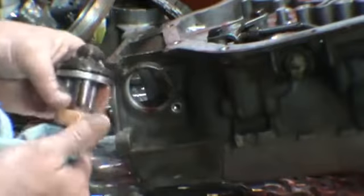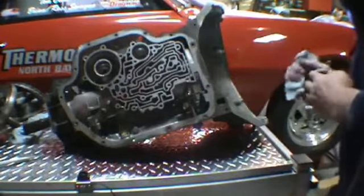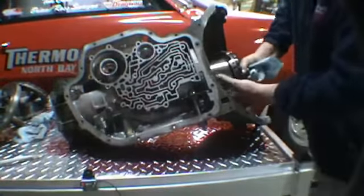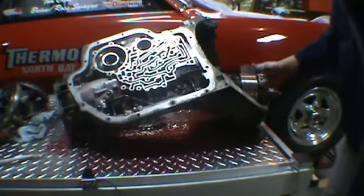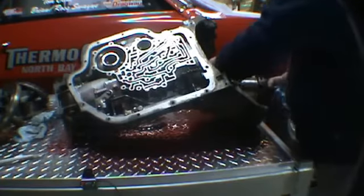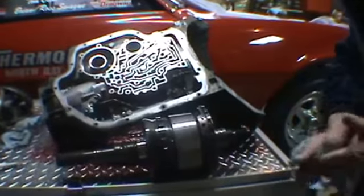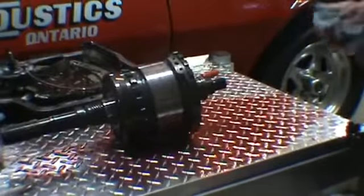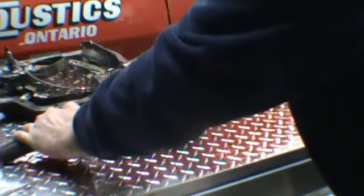The one gear goes on it. There's an O-ring around the housing. Then at that point, you can just go ahead and pull the whole gear set, everything out in one shot. Like so. We can go ahead and just take that center support off.